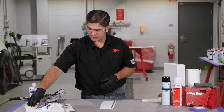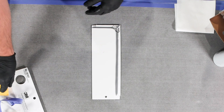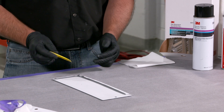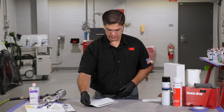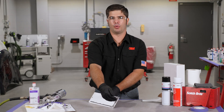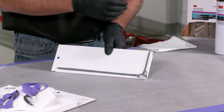While you're still within the working window, come in here and pinch off these corners. Some of the repair procedures will actually tell you how far in or how much they want you to pinch off — some might be a little bit further in, some might be shallow. The reason they do this is so that when the door is back up in a vertical position, water doesn't build up along that edge. We need to have a place for the water to drain out that might build up along the edge of that seam sealer, so we're not trapping it there and damaging the surfaces of our finish while the vehicle's being parked.